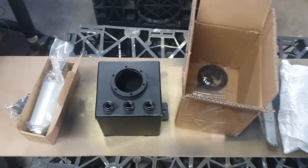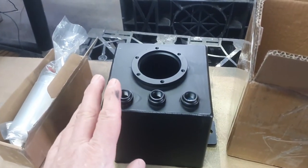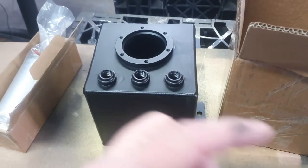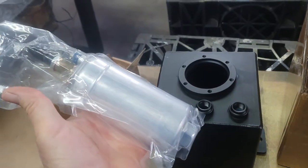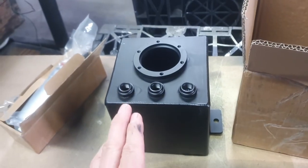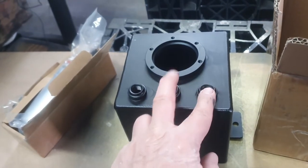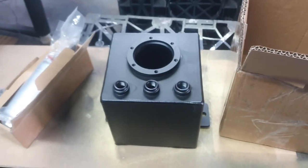So in other news — swirl pot. We've got the tank at the back and we've got to find a way of getting the fuel up to the engine, and to avoid fuel starvation issues you can fit a swirl pot. These are quite clever now because what they're doing is you basically get your Bosch 044 pump — this isn't actually a genuine one but it's the same thing — and that fits down in a hole and directly sucks from the bottom of the swirl pot. So you get fuel pumped from the main tank into the pot, out of the pump, off to the engine. You've also got a return from the engine and a return to the tank, so you've basically got three fixings on there to connect up to. That will have to go in the boot.